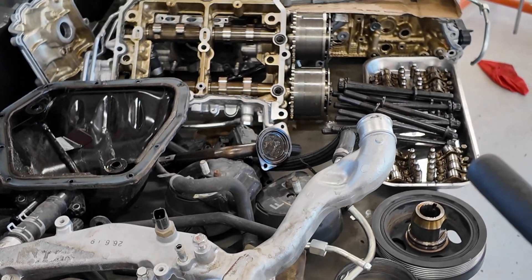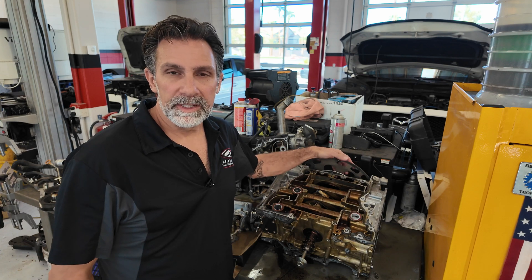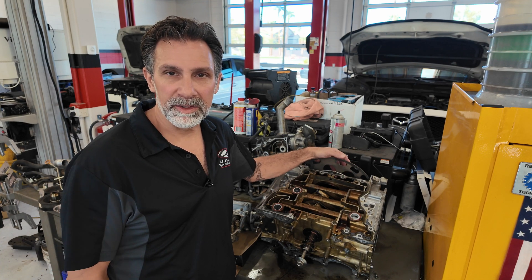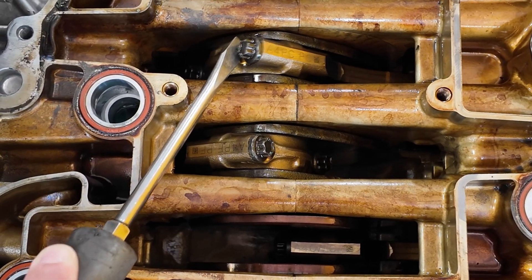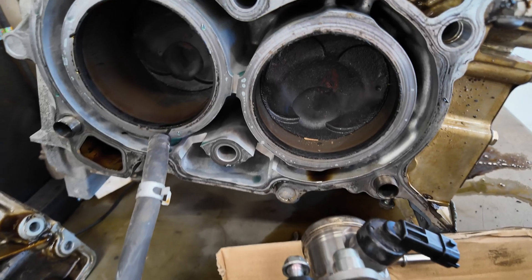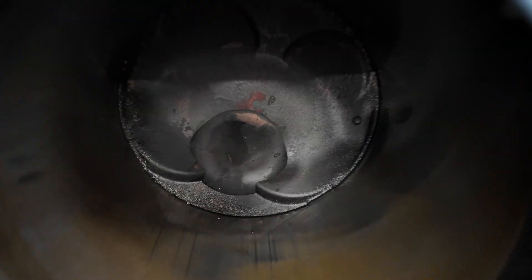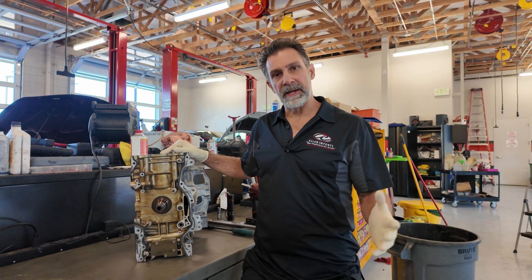This is right about where the do-it-yourselfer is contemplating some life choices. We had a little bit of work to do to get this engine all the way stripped down to the engine block so that we could take a look at the connecting rods and see what exactly failed on it. And that noise we heard — I think we found it. We've got a lot of work ahead of us. We've got to go through all the components, probably check the cams and all internal components to see if there's any other damage. Everything's got to get flushed out and cleaned up before we can reuse any of these components. We're going to strip this all the way down to the crankshaft so you can see exactly what's on the inside.